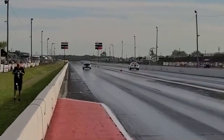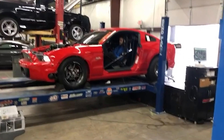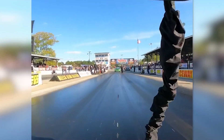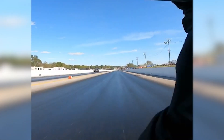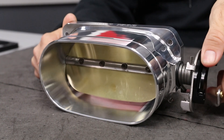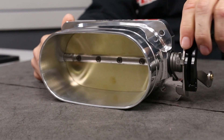Why are we doing this, you may ask? A couple of reasons. We've got a lot of racers now running Holley EFI on dedicated race cars. They wanted a bigger VMP throttle body to fit their Gen 3Rs and their Odins, and when people want stuff we just gotta make it. So this is the answer to having a direct bolt-on throttle body that is super big for VMP superchargers.